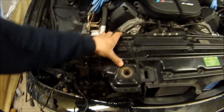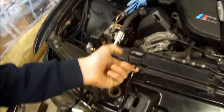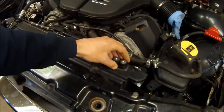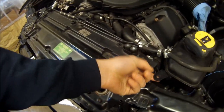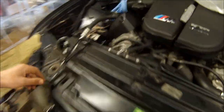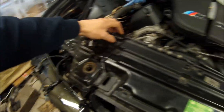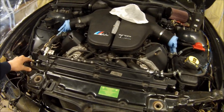I'm going to look at making some top radiator mounts because the current ones probably aren't up to standard, so I'm starting off with some rubber bobbin mounts. I'm going to sit them in there, then make a bracket, incorporate a mounting for the coolant reservoir, and do the same on the other side. I'm going to start on making a template for that.